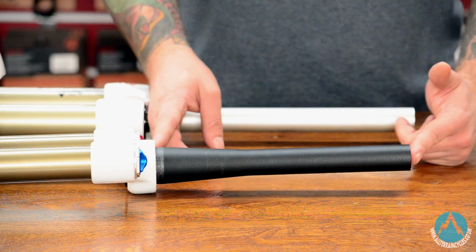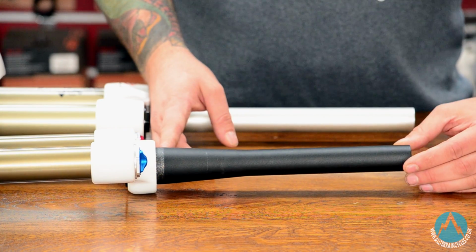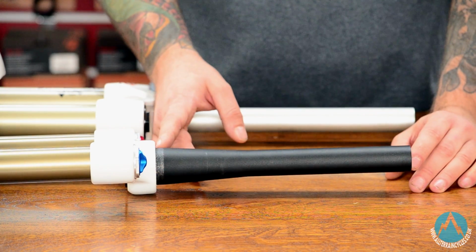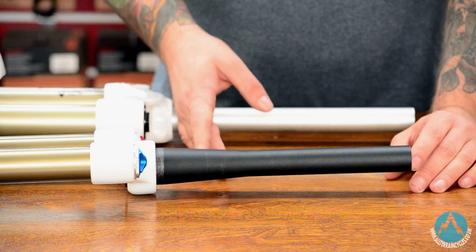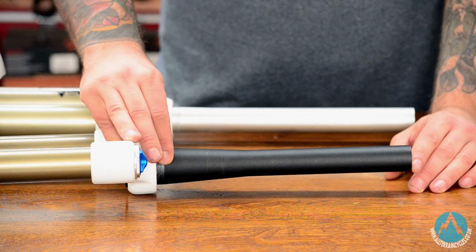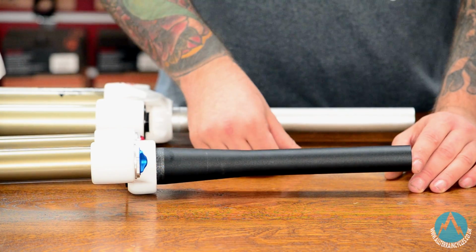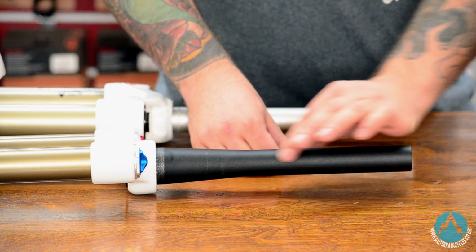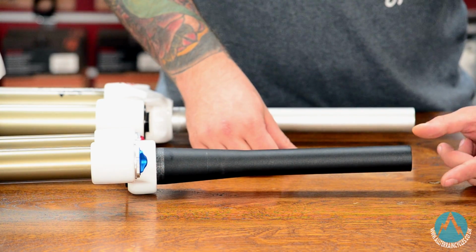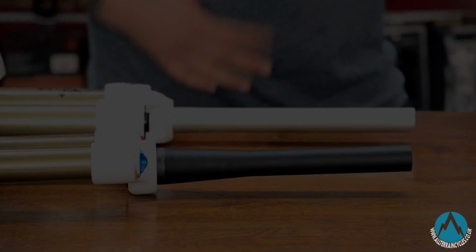The newer bikes tend to come with the tapered systems, so they'll still fit a standard 1 1/8 stem on the end, but you do need a frame which is compatible with a tapered head tube. 1.5 inch at the bottom tends to increase stiffness of the fork, and you're not getting quite as much wear or damage out the bottom cup. But keep it light, taper it off to 1 1/8, and the upside to that is you can still use all the standard stems on the market at the moment.